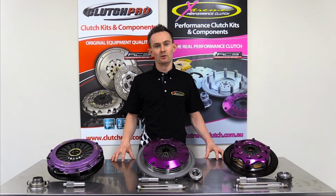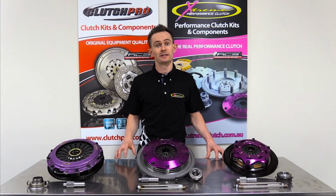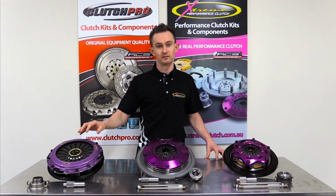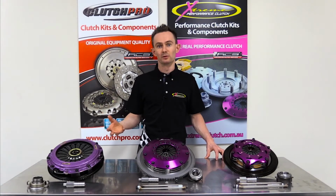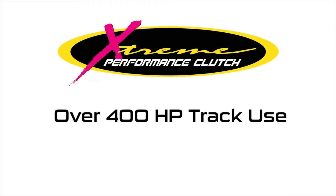If you're pushing a little bit more horsepower than that, say 500 horsepower at the crank, and you're still driving it on the street every day, then you want to stick with organic friction materials. So that's why we've developed the twin organic 230mm that retains the pull type mechanism for both of these Mitsubishis and Subarus. That's going to be far better and far more drivable on the street than something like a single ceramic.